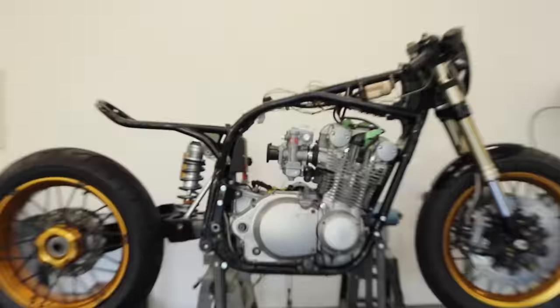So my brother and I worked a whole bunch on getting this thing wired up. We made a whole bunch of progress, got a bunch of stuff installed. Let me show you really quick where we're at and what we've done so far. Basically, the wiring breaks down into a few main components. We have this centralized piece here. This is called an M unit. These are super handy, basically replaces all of your relays and all of your fuses. You just run one power here, and then you can run all of your outputs here. So like ignition power, high beam signals, start, all that kind of stuff.